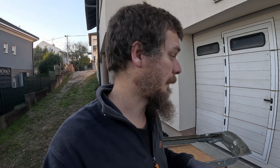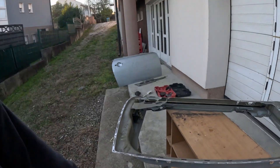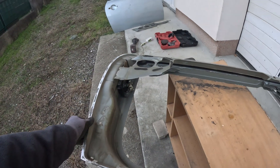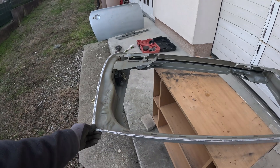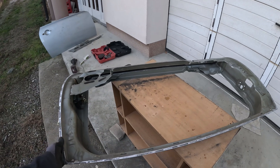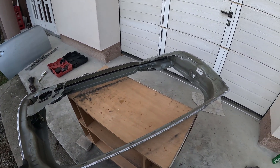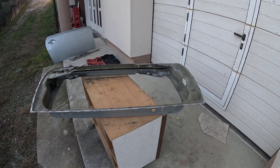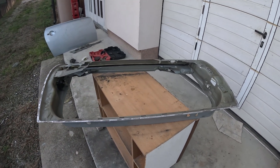We don't have the video of that but we will be making the skin for the second door. We'll be making the mold for the roof and for the bonnet — that's probably the next video. Today we're finishing this door. With everything right here it's a bit less than seven kilos, so with the skin we're at around eight and a half, which is not bad. If I bought completely plastic doors they are around eight and a half kilos — money saved and some stuff learned.